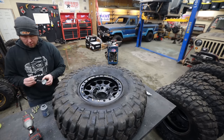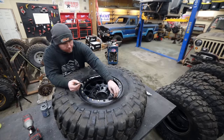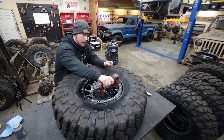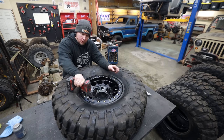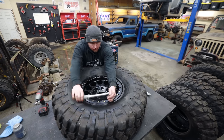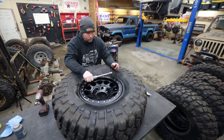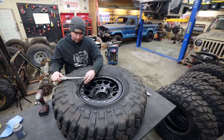The next thing I do is put anti-seize on every single bolt that's going to get threaded in, and then I use the weakest impact I have — well, the second weakest — to drive all of these bolts in in a star pattern. The star pattern makes sure everything is seating nice and evenly, and then I do two full circles all the way around. The reason I do that is whenever you tighten one bolt, it loosens the two next to it, and my impact is somewhere between 15 and 17 foot-pounds, so it's nice and weak — perfect for this job. Then I whip out the torque wrench. I've seen beadlocks require anywhere between 17 and 25 foot-pounds. A lot of people don't even torque them down. I do it because it means in the future I'm never worried about it — I know we have even torque on every single bolt head and I don't have to come back and make changes later.